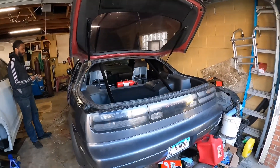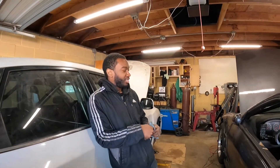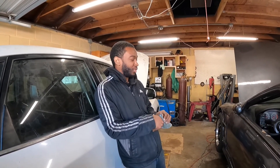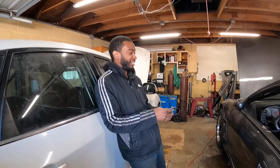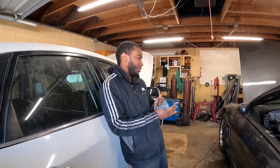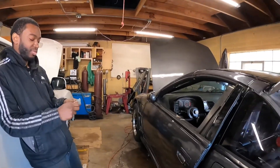She's gonna get her first startup today. What changes did you make on the car? Since we drove it back from the track, the car has not been turned on once. I changed the injectors from 60-pound injectors to 210-pound injectors — so they're pretty much three times the size they were before. I got some tuning challenges ahead of me. That's pretty much the only thing changed engine management wise.